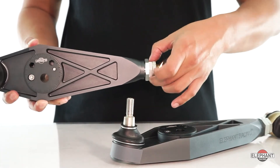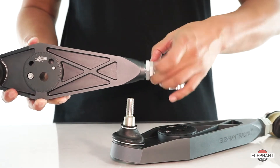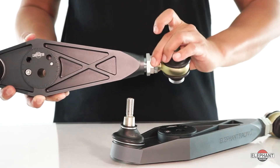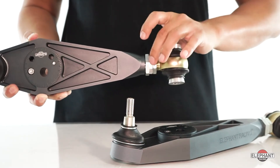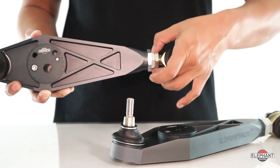Length is easily adjusted by rotating the center hex head. Rotate clockwise to expand or counterclockwise to contract the arm length, meaning adjustments can be made within minutes — no shims to mess with, making it the perfect setup for quick changes at the track.